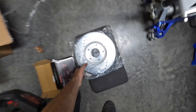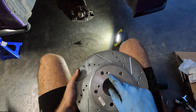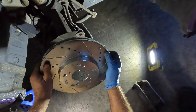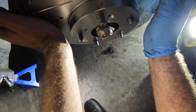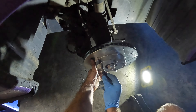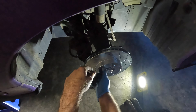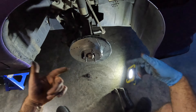We've got our new rotor here — it's going to be our passenger side rotor. Basically just going to slide that on. If you want to reuse the alignment screw, you can see the hole on the hub, so line it up. Notice how it says 'front passenger side,' so I know we have the right one. The way I'm going to align this is to take a lug nut and just hand-screw it all the way on to hold the rotor straight. It doesn't have to be perfect. Now we just have to do everything in reverse order.